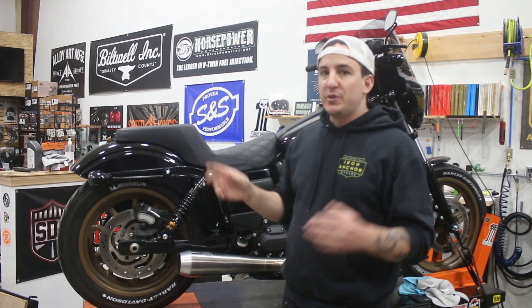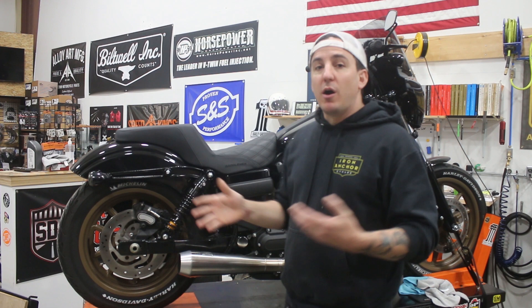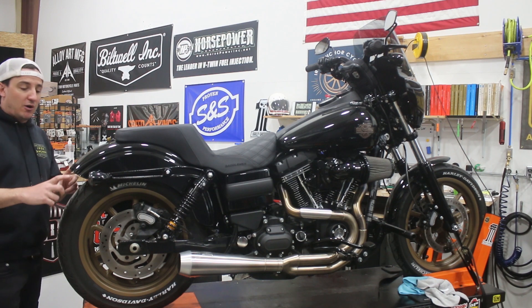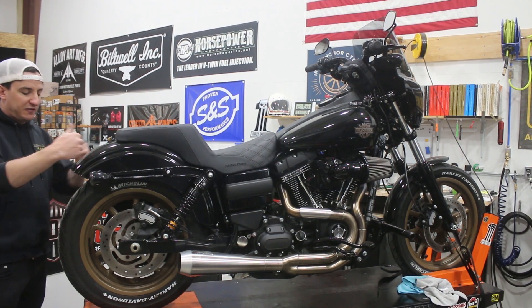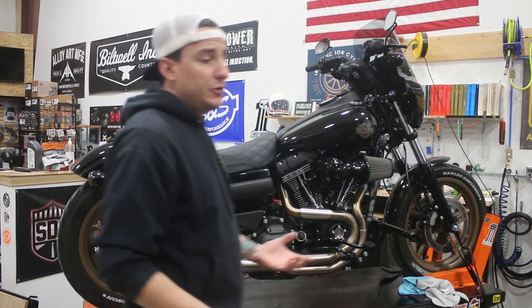In a situation with a bike that had a full rear fender, you could pretty simply just put an integrated tail light on in place of the one that was on there — there are your turn signals — and mount the license plate up on top or really anywhere else. In this case there are some options. We've done it on Fat Bobs and on Street Bobs that also have the short fenders, where we've put the Cycle Visions license plate bracket on that includes turn signals, brake lights, running lights — all that stuff. It kind of brings the fender down, your license plate goes in there, and it looks really clean. It's a good solution.